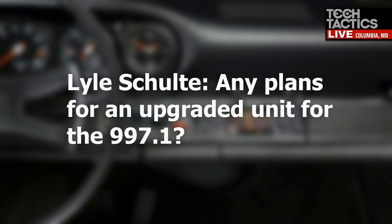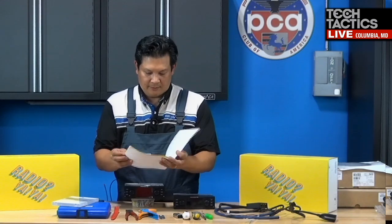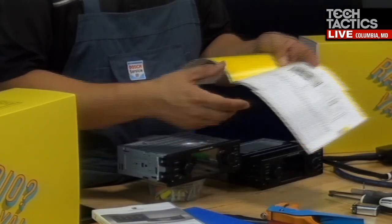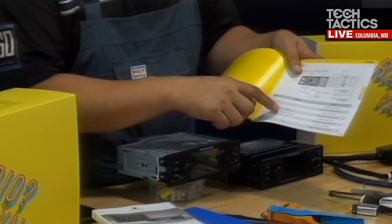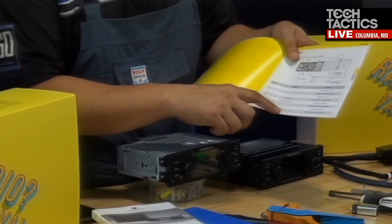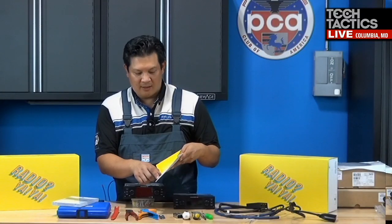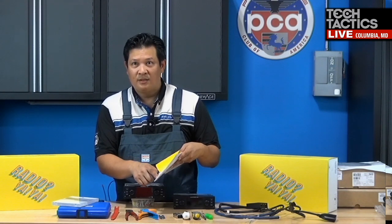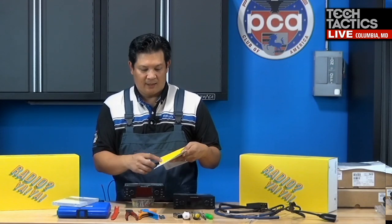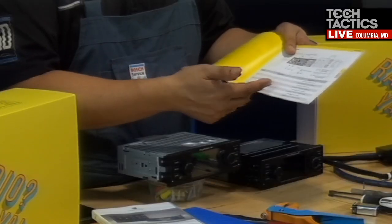So you can make it work. Again, in the Porsche Classic manual here on page 11, with that harness that I made, it tells you all the pin configuration. It tells you battery, antenna control, accessory, and ground. That's going to be very simple for you to find in your Boxster. And then it has all the pin locations for your speaker. So again, it'll fit because it's a single DIN radio. It's a universal fit. You just need to match up power, ground, accessory, and antenna control